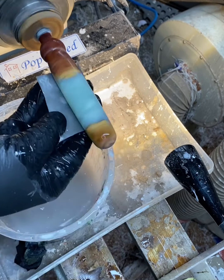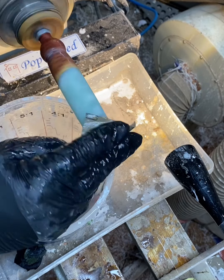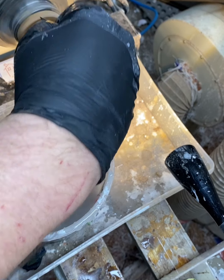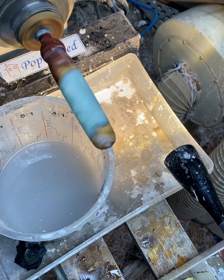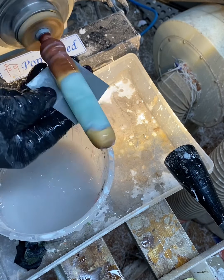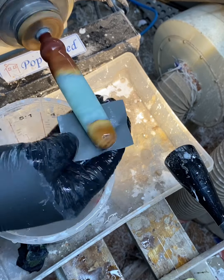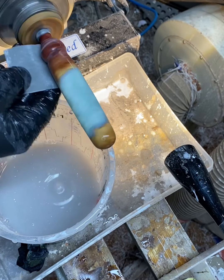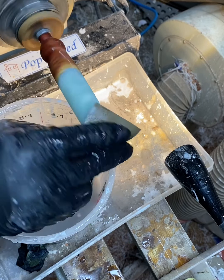If you're wondering where I get my wet sandpaper from, I get it from Body Shop Paint Supplies. They'll have all the grits you need in wet sanding paper. So all my really super fine stuff, 1500 onwards, I get from there. I also get my final buffing paste from there. I'll show you that later. Everything else, Bunnings, mate, just Bunnings. So that was 2000, now we're at 2500. And that's that.